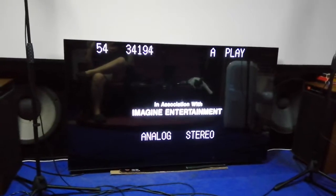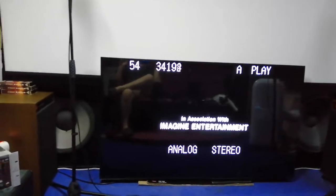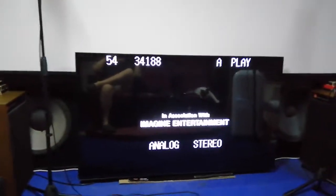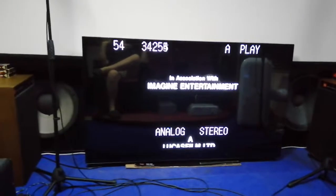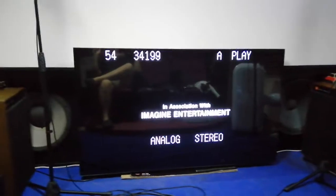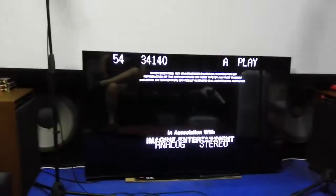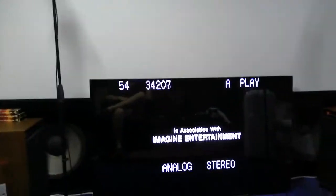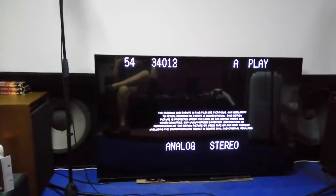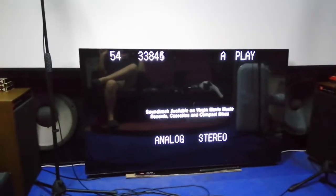Oh yeah, I can hear a little bit of laser rot on there. That's typical. Because if the laser rot gets really bad, it really takes out the analog track. And if you could persevere by still watching the movie, just barely, because when it gets like that, the laser rot is really going across and it just gets in the way. It can kind of hiccup the pulse code modulation with a skipping sort of sound or whatever.